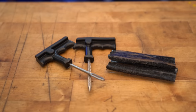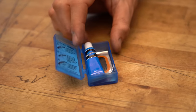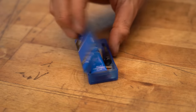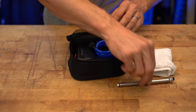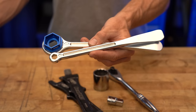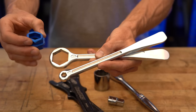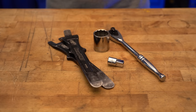Whatever style wheels and tires you're rolling on, being able to fix a flat and remove your wheels and tires is something you should be equipped to do. I carry rope plugs and a modified reamer and installer for tubeless tires, plus a patch kit for tubes. I like these Park Tools Bicycle Kits because they're compact and the box protects the tube of glue so it doesn't get popped or punctured. I stash a valve core tool and a razor blade in here as well. When I'm on a big trip, I pack a 12-volt compressor rather than a hand pump or CO2 canisters. I use the bag to hold a tire gauge and the rest of my tire repair stuff, as well as a few extra rags. For wheel and tire removal, these combo tire spoons from Motion Pro are my go-to because they pull double duty with an integrated wrench and adapter for removing axle nuts — a lot better than hauling around a ratchet, a 3/8-to-half-inch adapter, a heavy steel socket, and separate tire irons.